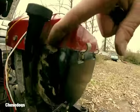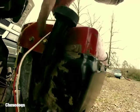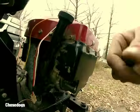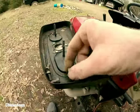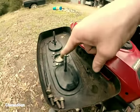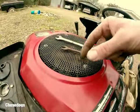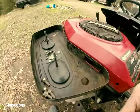I was mistaken thinking there was one bolt holding this dipstick tube on, but there's two. Those bolts are going to be a 5/16ths socket. You can either use a quarter inch drive or a 3/8ths drive — it's just your preference, either one will get the job done. To keep your bolts from getting lost, you can put them up here in the air cleaner tray. Just make sure you close that butterfly valve so none of your stuff goes down in there. It's helpful to put your stuff in there so they don't get knocked off and lost.